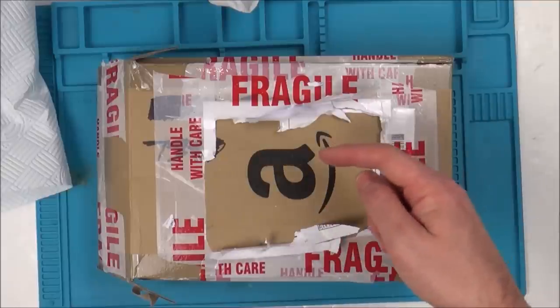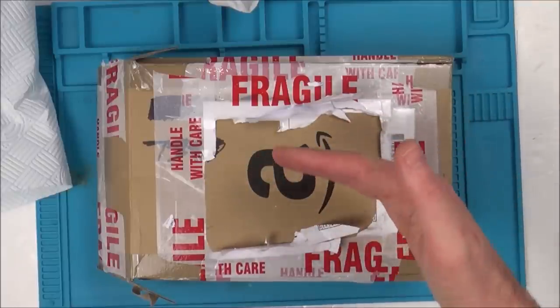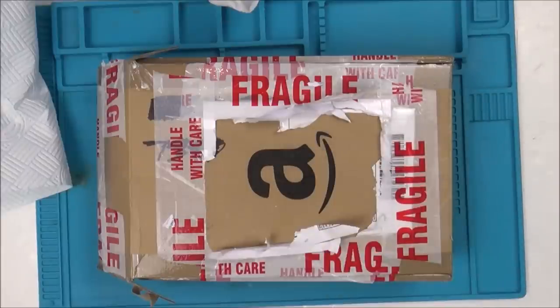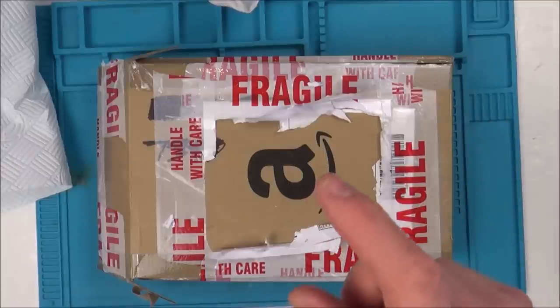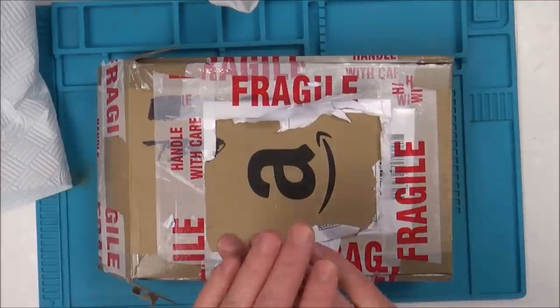So you can see one lot of pins, just like you can, for example, on an HDMI port or a normal USB port, but then there's a hidden row of pins underneath the port, so you're relying purely on heat to have hopefully melted the solder in order to make it stick. Now, I do not know if the Nintendo Switch Lite has the same USB port as the Nintendo Switch, so this is what my thinking is before even looking at it.